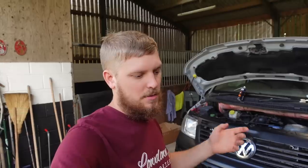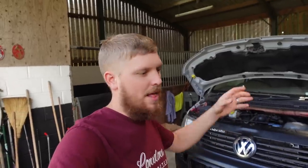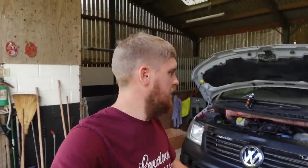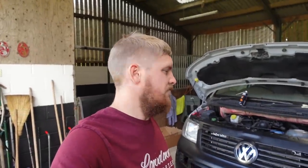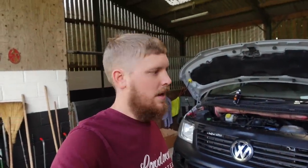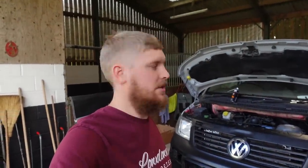A few people on the last video suggested it could be the EGR cooler, but this engine is that old and an early one — it hasn't got an EGR cooler, just a pipe from the exhaust to the EGR valve itself. So really the next thing is just to whip the head out. As much as I don't want to do it, it's more money and a fair bit of effort, but it's just the next step.